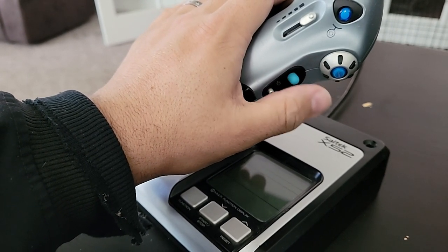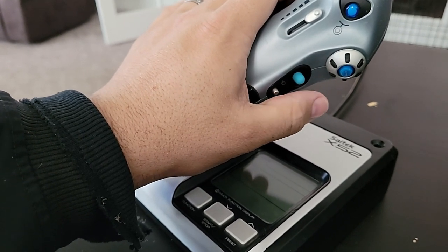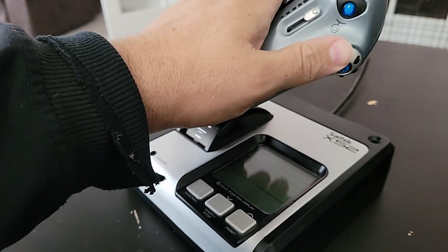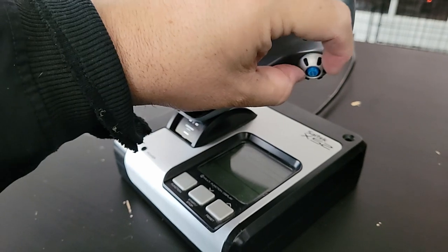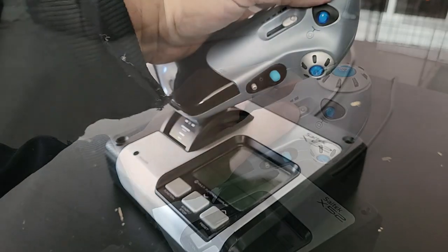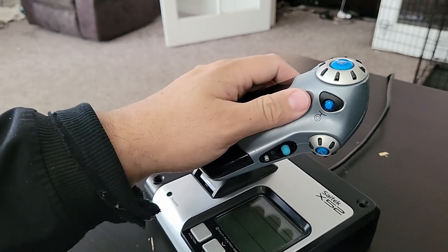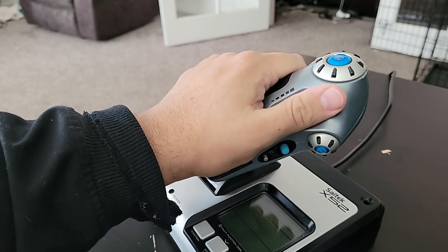This is kind of like an analog joystick, but it's super inaccurate and really annoying to try to use. To my knowledge, I don't think that it can be mapped to be an analog stick, but I'm not really sure I'd want to use it for one, even if it could. It has two axis wheels on the throttle that can be used as trim, or in a space game, you could use them as speed limiters or mining laser throttles. There's a slider axis for your thumb that could also be any of these jobs. The slider tends to develop a little bit of drag over time and may need some disassembly, sanding, and lubrication to make it smooth again.